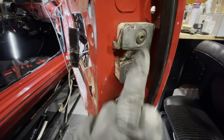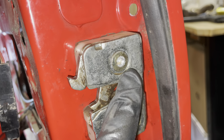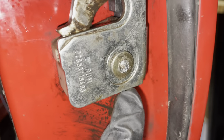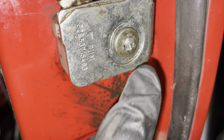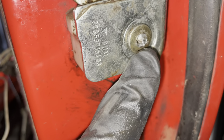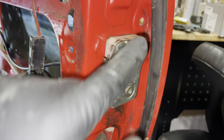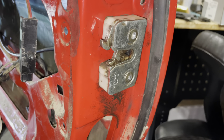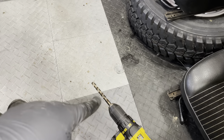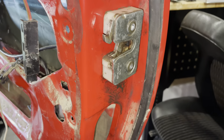The extractor set did not work — it's not biting in. I also tried hammering other sockets in, but the bolt is too soft and just gives way. I'm going to drill it out with a big cobalt drill bit. Once this piece is off, I should have enough space to grip the vice grips on the other side and get the threads to come loose.